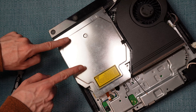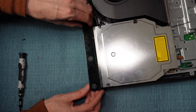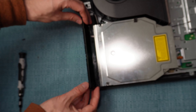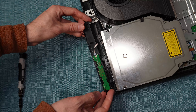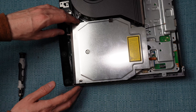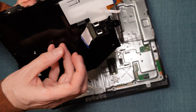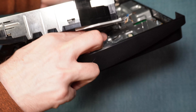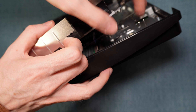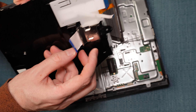Next you have to remove the disk drive. Remove the one screw that's holding it in. On the other side, pop out the panel that has the eject and power buttons on it — there is a ribbon cable attached to the bottom, so don't yank the whole thing out. For now just lay the panel to the side. Next, pull up on the disk drive and remove it. On some variations there's a very short ribbon cable underneath it. If yours has one, hold the drive up with one hand and place your other hand underneath to pull the ribbon out of the connector. If your hand is bigger than mine, you may want to find someone with smaller hands, or stick some needle nose pliers underneath and pull the cable out that way.